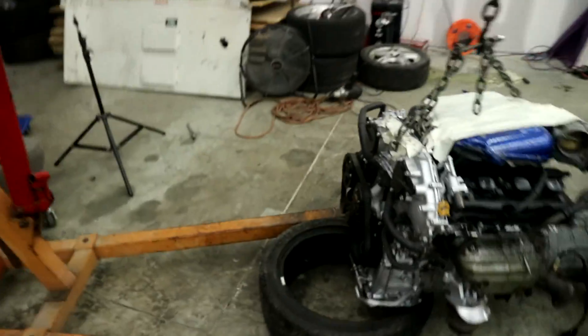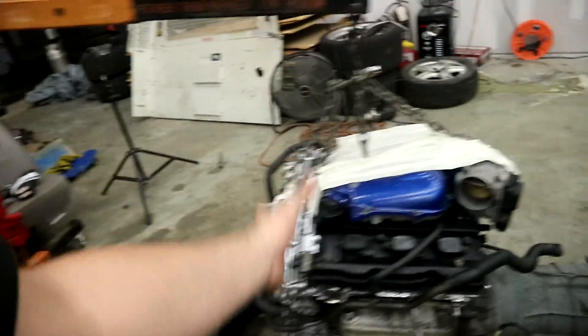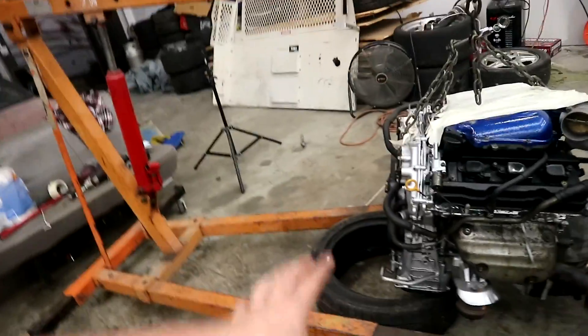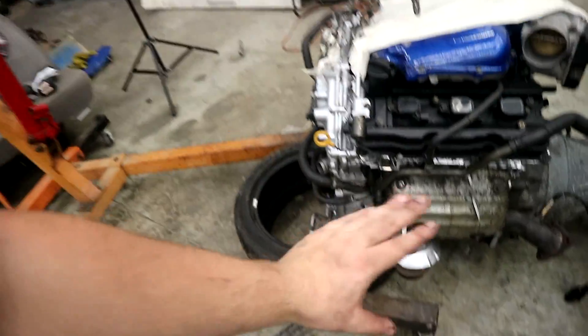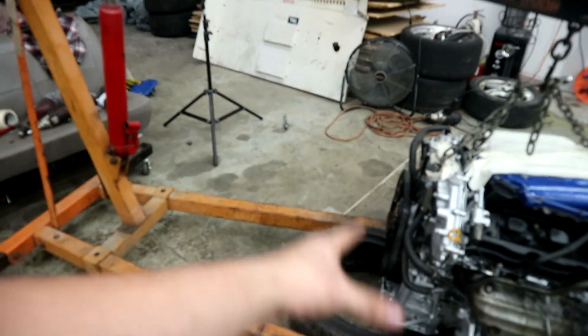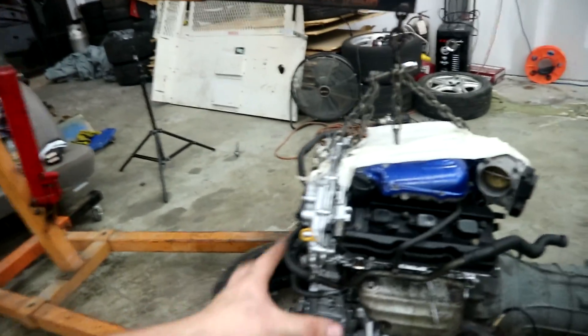I got farther than I thought I was going to. I originally thought I was going to get the engine in, but things take time — I forgot that chain guide piece and it kind of went downhill from there. But the engine is all together, all sealed back up — new head gasket, all new RTV everywhere. The upper oil pan, which is the biggest pain in the car, is done. Lower oil pan is done. It leaked from both before, and now that the engine is painted and clean, I'll be able to see any leaks.